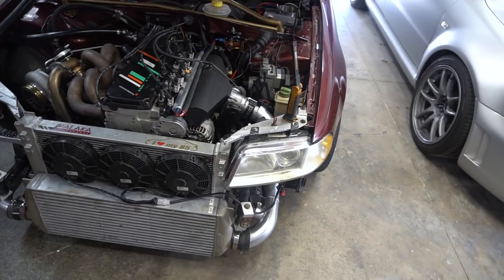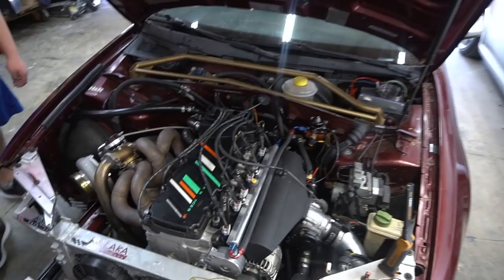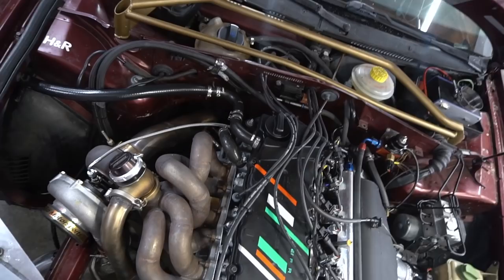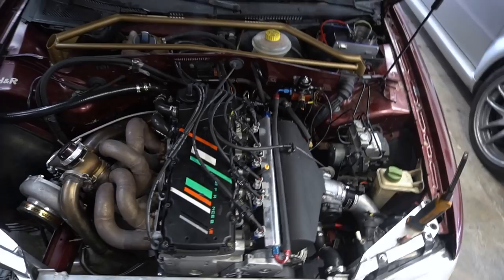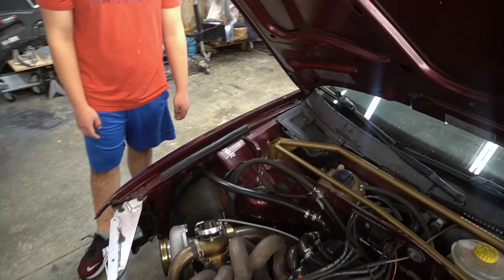Well, we gotta put a clamp on that one there. Where is it at? Oh, it's right there. But we're gonna have to sort this car out, get it tuned, driving, making some power, and then we'll have to route the vacuum lines and put his boost controller probably mounted on that firewall there and run the vacuum line. So when he starts driving, he can actually put some boost other than wastegate pressure to the motor. But so far, so good. I'm excited. Come on, Stav, are you done loading the file or what? Stav's on Facebook probably.